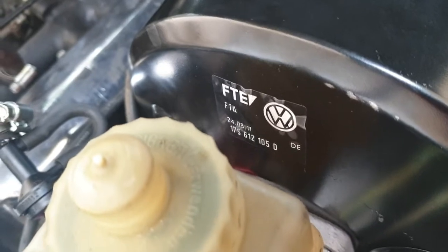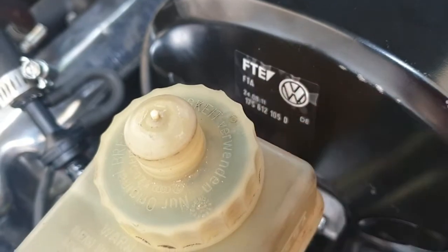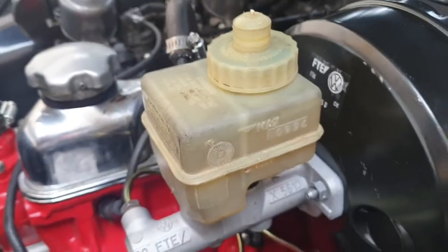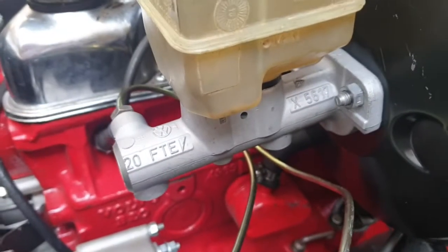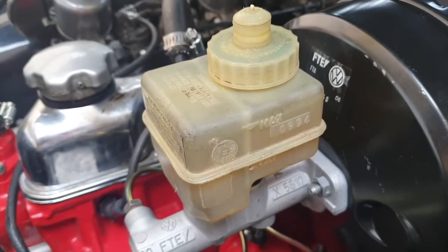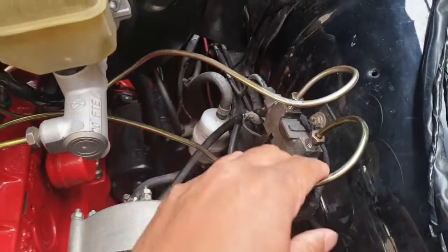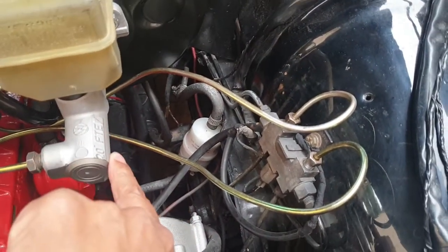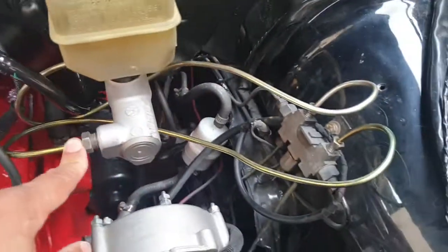This is the original VW part — if you want it to look like a Volvo part you can always pick out that VW badge. I also had to get a brake fluid reservoir for the Golf to fit the master cylinder, as it doesn't come with the kit. I couldn't find a new one so I settled on a used one. The last bit of modification is for the brake fluid pipes, which sit on the other side of the cylinder, so they come in with a twist.